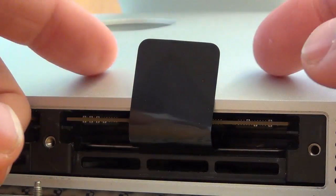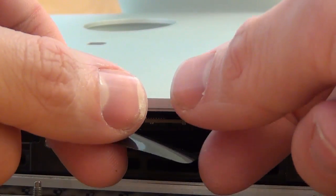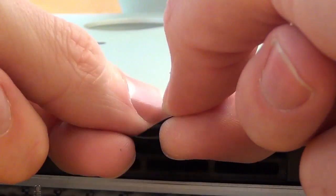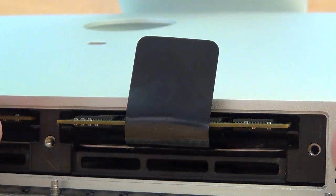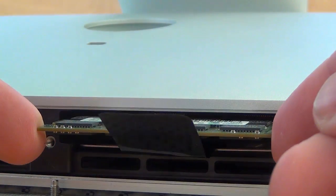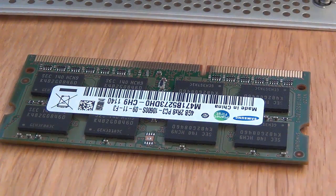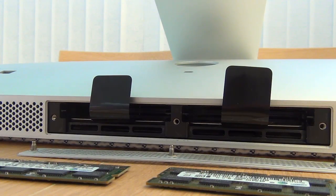What you need to do now is pull out the existing memory that is inside the iMac. This is done by pulling hard on the black toggle — whatever it's called — and there you go. This can be tough, but once released the memory should slide out with ease. Take note of how the memory looks when it first comes out — the longer connection is to the left.